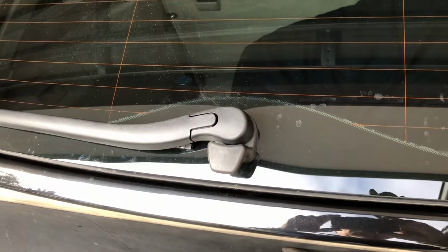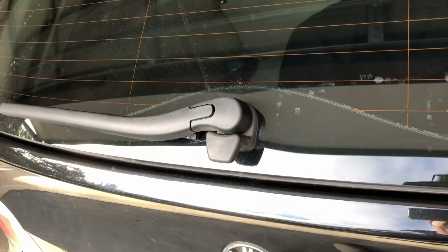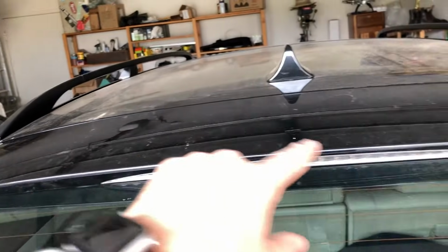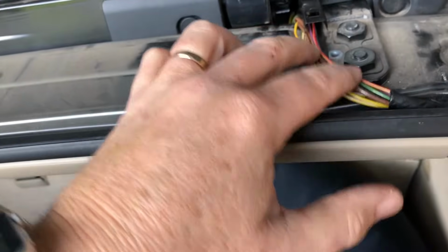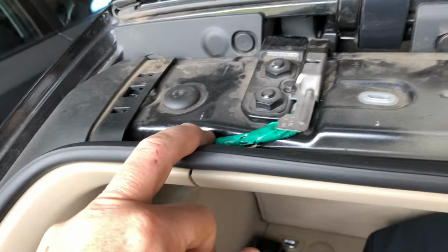This micro switch. I've had the button opening and I've been investigating the wires, because the best advice I was given was that the broken wires up here where they come through in the loom under that rear spoiler. I've got a video here you can have a look at where I pulled that apart to chase that down, and I've also opened up and unwrapped all of these wires, because I do know that they break, because I've had one break on this side and had to put in a new wire.